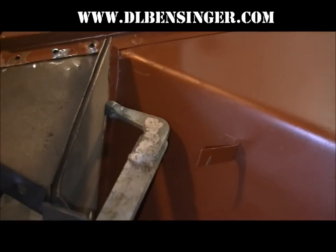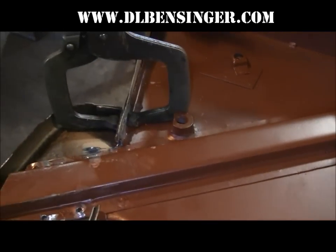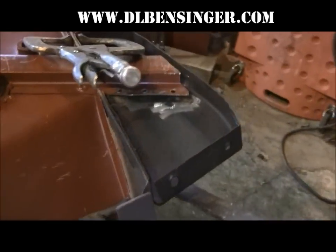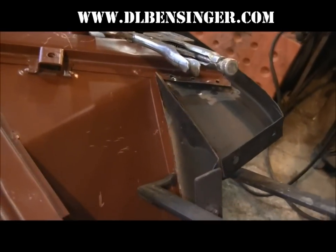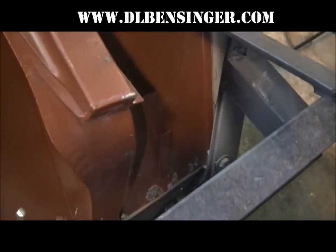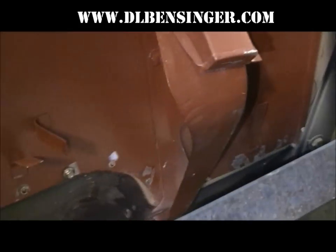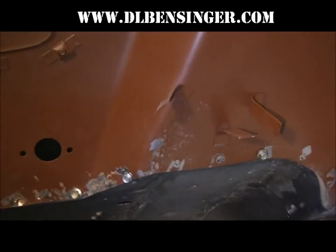We've got clamps to clamp the other sections together, holding this floor in position. What we'll be doing is welding a little bit, moving the clamps along, welding some more, moving the clamps along, welding some more, making sure everything is tight and we've got a nice proper fit up. So now after quite some time here, we're finally ready to start welding.